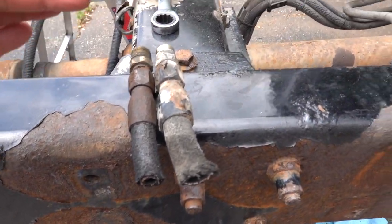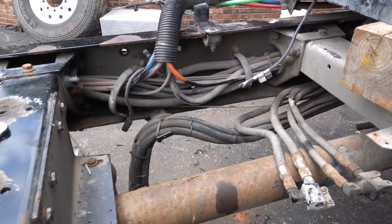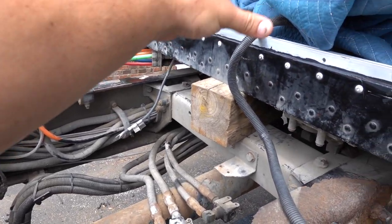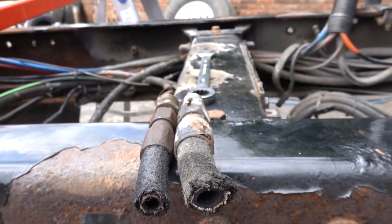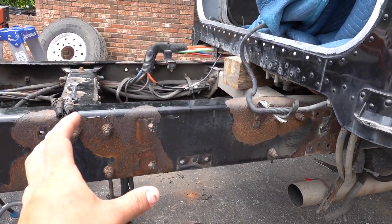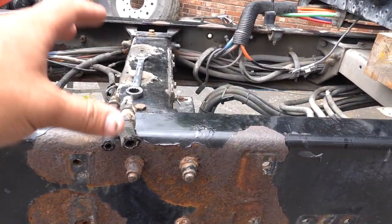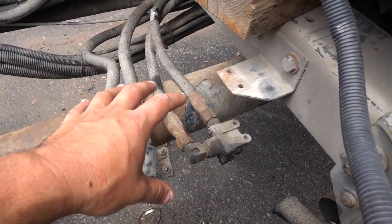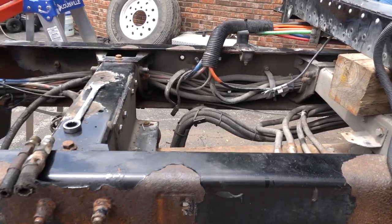In the meantime, I went ahead and took apart some of the fuel lines. We are going to be replacing all of the fuel lines from the tanks, the returns, all the way to the front. These lines are kind of rusty, really brittle, and I'm assuming they might actually be original. Now that we're moving the tanks towards the back, we're not going to try and reuse the old hose lengths - we're just going to run all new fresh lines. We took apart some of these T's and junction blocks, and we're going to try and get all new lines and all new fittings.